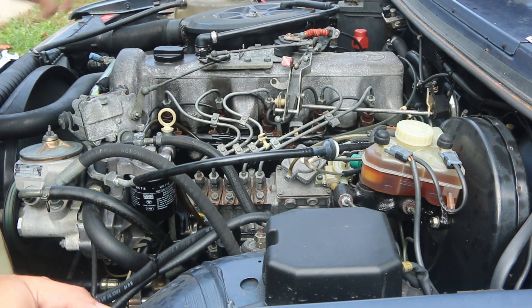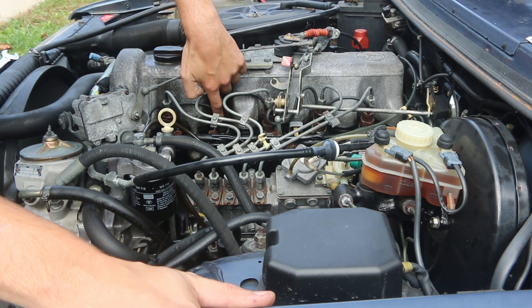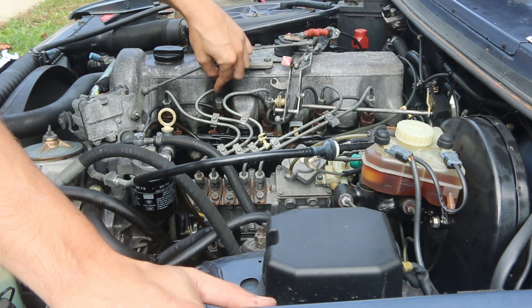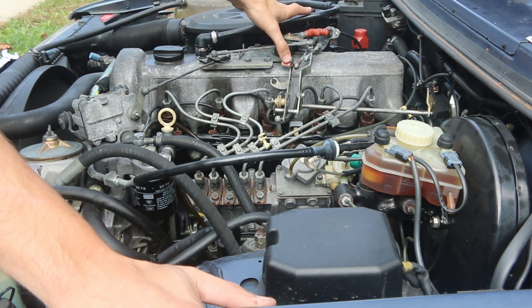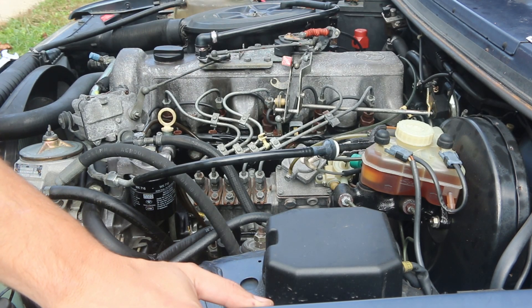It really hasn't gotten noticeably worse or better over time. I actually just saw — you'll never see it on camera, I imagine — but cylinder two is bubbling around the injector, so we've got compression leaking around that little crush washer. We're going to pull these out because I'll bet that bubbling is causing a misfire. Could be the injector has even got a wonky spray pattern, but I'd almost bet that it's injector related.